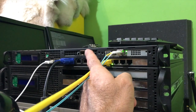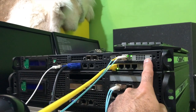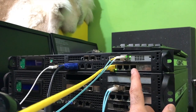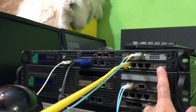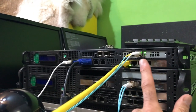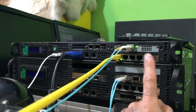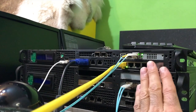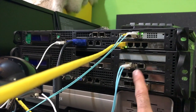Perfect for what you want, because you have the two X8 slots that you need for the two 10 gigabit cards, and I'm using Chelsio cards here. They're about $39 each on eBay, and a 4-port Intel card that came with the NetScaler. I happen to have upgraded this internally, because the cool thing about the 7500s is you can upgrade it. It has the identical dual quad cores, and I maxed out 32 gigs. Don't need it for this application. I'll probably remove that.